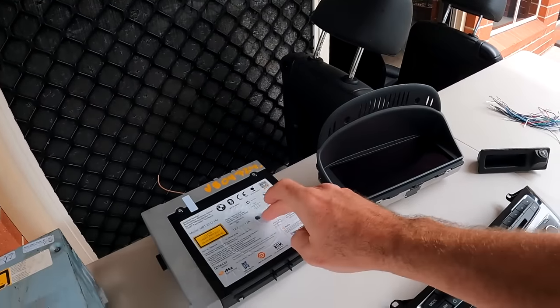I had aux in set up from the Android because most of the infotainment stuff — navigation and everything — I was doing through the Android unit, so I didn't need true CIC integration. Even doing a CIC retrofit was a huge thing five, six, seven, ten years ago. Now with the MBT I don't want to run the Android, because the MBT Evo I'm putting in — which is an ID5/6 unit — has full Apple CarPlay and touchscreen. CarPlay and touchscreen is where I'm at these days with infotainment.